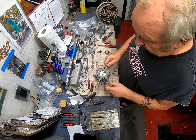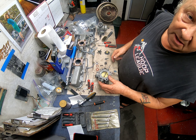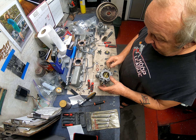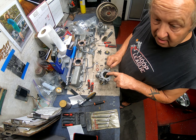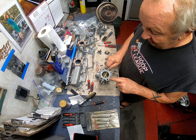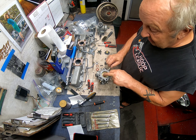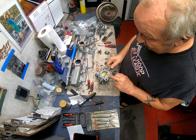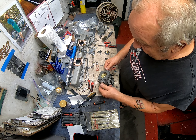Whilst the shaft was out I polished it - why not? When it came from the factory it was nice and new. Look at that - lovely, perfect fit. Do be careful when you're putting this back in: make sure you get it the right way around because it's got a chamfer or bevel on it, and it's in that position that it makes a perfect seal. If you try to put it the other way around it ain't going to work. Take lots of photographs.